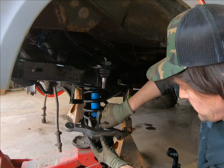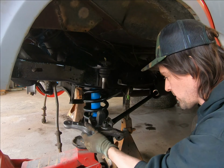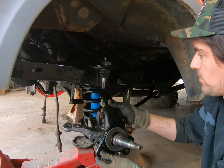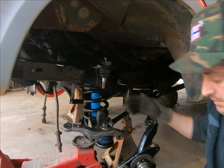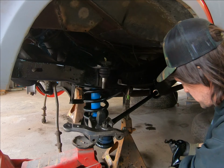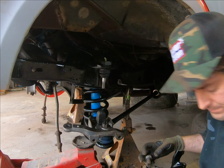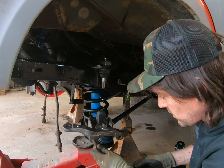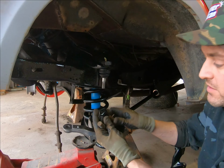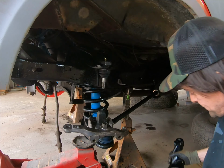We're going to fit it to where it's just snug, and then we'll press fit it later. So we'll kind of start with that, and then this will bolt to this. We'll fit it into this piece here. I got my bolts, which will hold to the tie rod extension here. So we'll get these ready, and it'll go through like that, right? So the head will be on the inside because of the shallowness, because otherwise it could hit your rotor, and you don't want that.